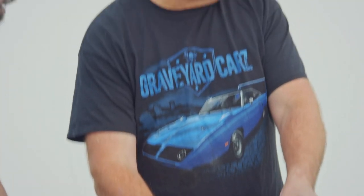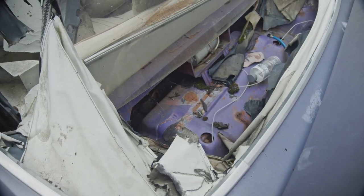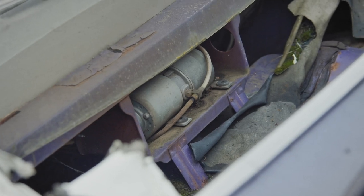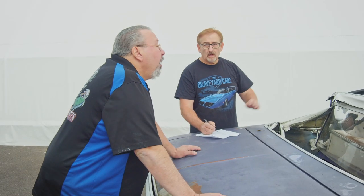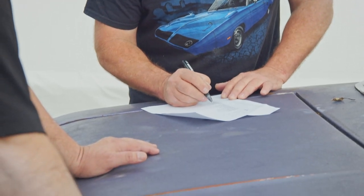It's original glass, and also the convertible top surround, the well surround moldings. If this was cleaned up and I called you and said I need a pretty darn nice set of glass, non-tinted convertible '70 Challenger — $400. It's the convertible pieces on this car that the value lies in. The great stainless is in nice shape. The convertible top mechanism — Tony's more optimistic than I am because he hasn't got to fix it. The lines are probably rotten and the motor's not a high-quality item. The top frame: this is where they all rot out on the header panel, and the header's rotten on this one. It's repairable but it's a lot of work. Retail, a convertible top frame goes for around $2,000.